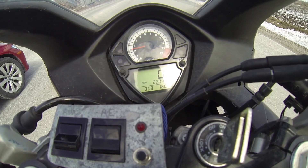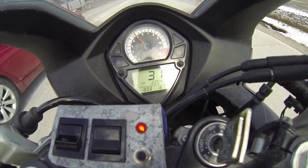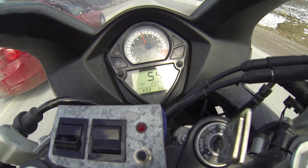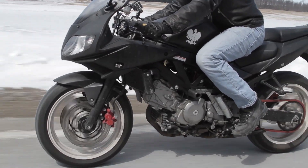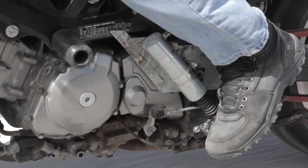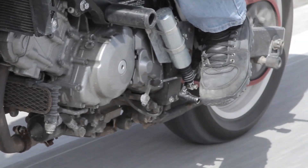The green LED on the side of the dash indicates the shift. This is just the bike accelerating. Now because this is actually with load on the wheel, the RPM actually drops by about 1,000. Whereas in the previous test it only dropped by about 500, because it's a lot easier for the bike to maintain velocity without a load on the wheel.